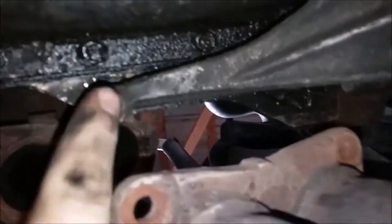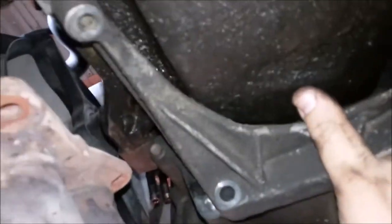You have to take the exhaust off — there's a bolt here, a bolt right here, and one more nut right here. These are all 17mm and you should be able to get them with a regular ratchet. Make sure you have your safety glasses on because exhausts have lots of rust that might fall in your eyes. After you get those bolts out, you need to get the bolts on this brace — the ones on this side are 12mm and the ones on the other side are 14mm. After you take those bolts out, the brace should just come right out.